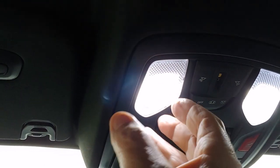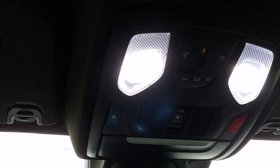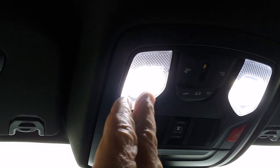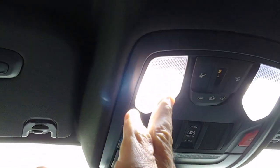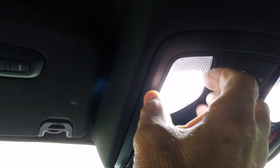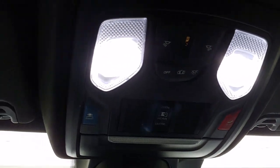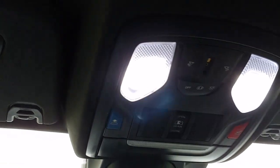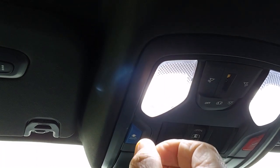In this 2023, they slipped out, but they didn't come all the way out because they hang up on the bulb. The back of that bulb has an articulating socket that allows the bulb to be moved like so, so that if you pull down on those internal reflectors, the bulb will move and those reflectors will come out. Once those reflectors come out, you can remove those bulbs with your fingers if they're small enough,